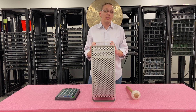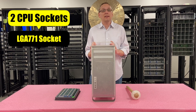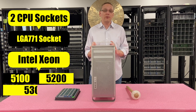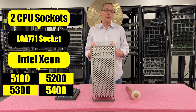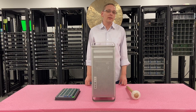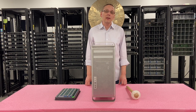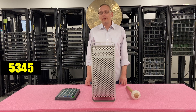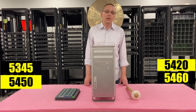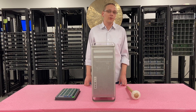We're going to start with the CPUs. There are two CPU sockets — it's an LGA771 socket, which means it uses Intel Xeon 5100, 5200, 5300, and 5400 series CPUs. You can put in a number of really good CPUs for relatively cheap these days. I recommend anything in the 5300 or 5400 series — 5345, 5420, 5450, 5460. Just make sure that you put thermal grease on top to keep them cool.